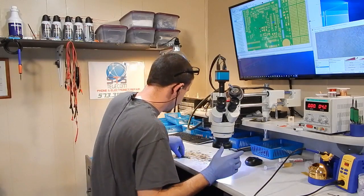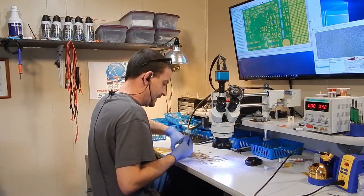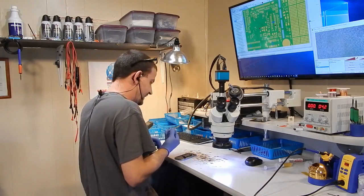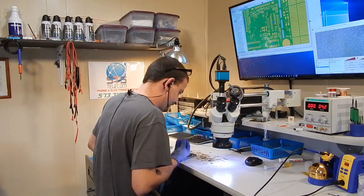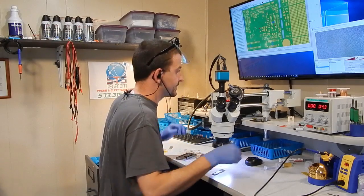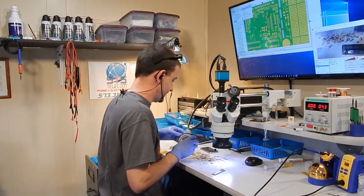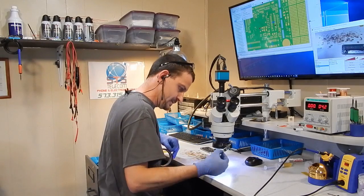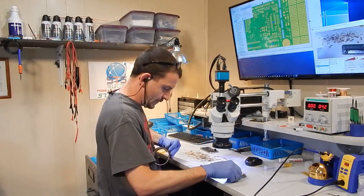There's not like a book on how to rewire the iPhone SE backlight circuit. We're going to drop this thing back in the housing. Before I do that, I would like to be extra safe. I'm going to drop a little piece of Kapton tape here in the housing right where our wire is.